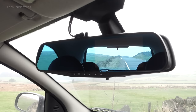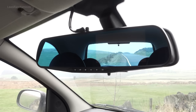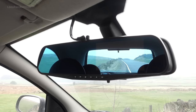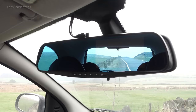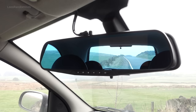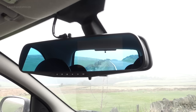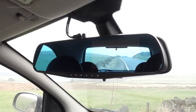After months of doing this, there's a possibility you can fill your memory card up with these protected files, and it won't ever erase them. There's also a strange quirk with file sizes: if you have cyclic recording set to 3 minutes, each front camera file is roughly 300 megs. But if it protects a video that's only 10 seconds long, it still takes up about 300 megs — the same as a full 3-minute video. I found my memory card was 90% full of protected files, with only about 5 minutes of actual driving recorded. On a 16GB card I get roughly an hour and a half of recording with front and rear cameras.